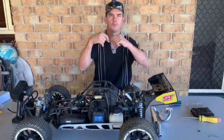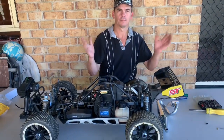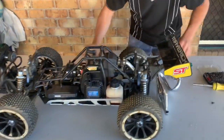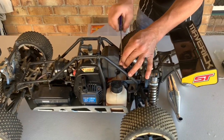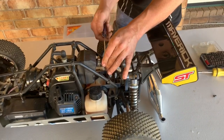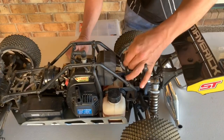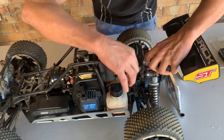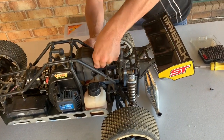So here we go. Now you've heard what it sounds like with the standard exhaust. Now we're going to remove this, put the pipe on, and see what the difference is. So let's get into it. Alright, trusty glasses. Okay, so first we'll remove these two clamps. We'll get this old exhaust extension off, pull it through that little retainer at the back there and get him off. Won't be needing that anymore. Okay, here we go. Now time to pull the can itself off.